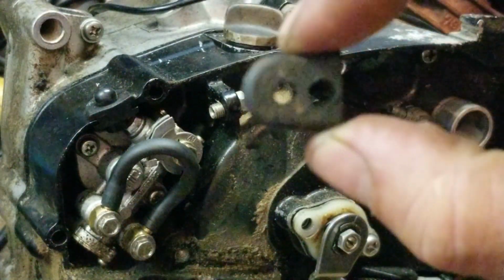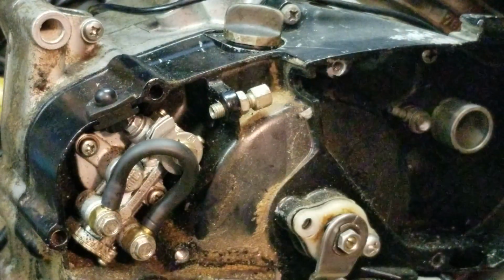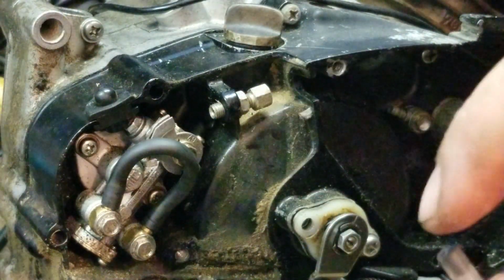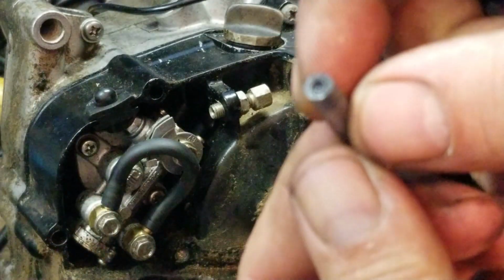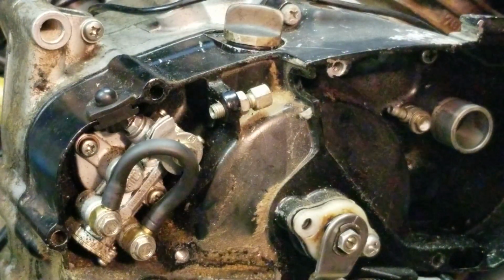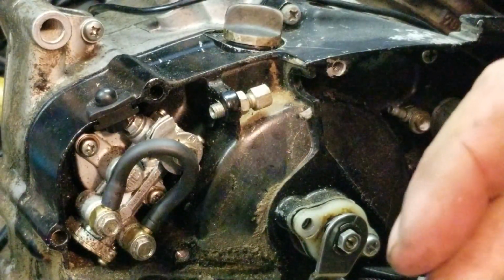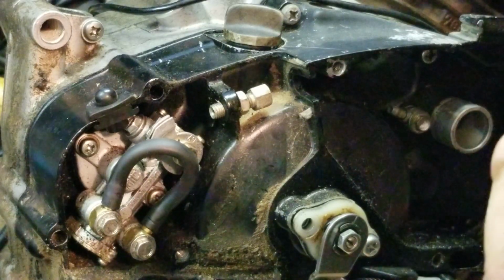And there's 2 holes in that grommet. So I just take a piece of the hose, that, you know, your oil hose. I cut it and I fill it up with silicone. RTV silicone. See right there? I got silicone there and silicone there. I'm just using RTV black. Goes on the outside one.